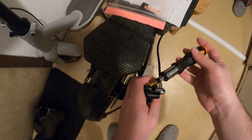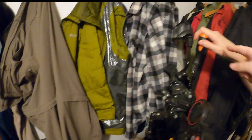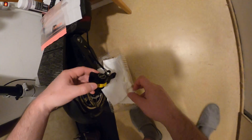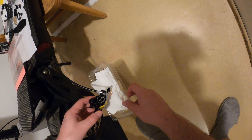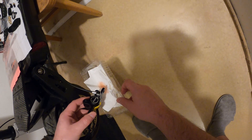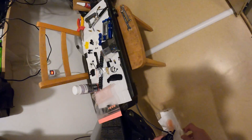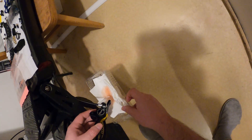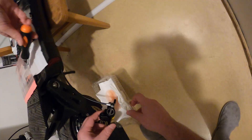Once you clean off the wires, the next step is to drain the oil from the existing brakes if you are replacing hydraulic brakes. If you are replacing mechanical brakes then obviously you don't need to do this step. The easiest way to drain the hydraulic brakes is to remove the bottom screw and have someone help you hold the caliper over some oil absorbing material. Once the top screw is loosened the oil should drain out of the system. This way you avoid the mess later on when removing the oil lines from the scooter. You can also press the brake lever several times to help speed up the oil removal.